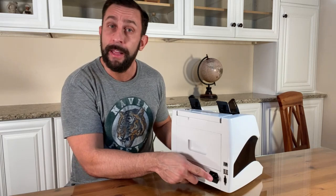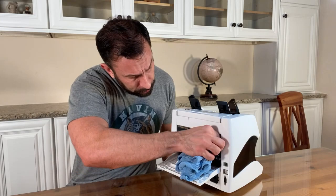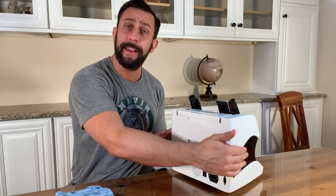Next we're going to talk about how to clean your machine — it's actually easier than you'd think. Make sure it's powered off; I've pulled the power on it as well. Open up the back door and you'll see this little black tab. Apply a little bit of pressure to pop it down. Inside, look for any debris, any pieces of paper or pieces of bills, then wipe down the inside to make sure it's free of debris. Money can be dirty, so you'll want to clean it out on occasion. Then push up, even it out on each side, close the back, turn it back around, plug it in, and you're ready to go.